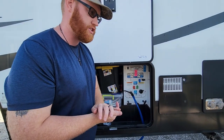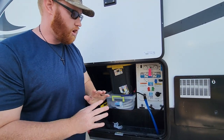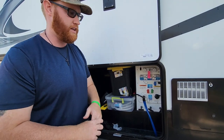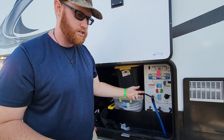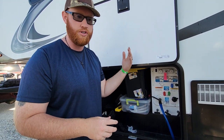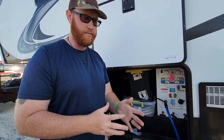In this episode, we're going to show you how to dump your tanks. You're going to have a black tank and a gray tank. Always, always, always, the first tank you're going to want to dump is the black tank. The reason for that is you want to get all the number twos and ones out. Then you're going to use the soapy water, which comes from your gray tank, from your sinks, from your showers, all that soapy dishwater. That's what's going to clean out the rest of the black tank water.